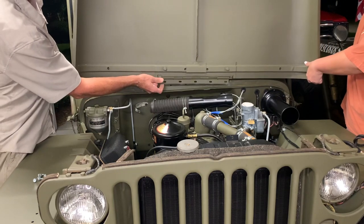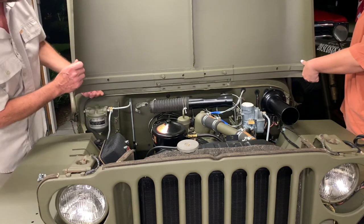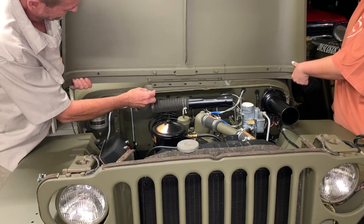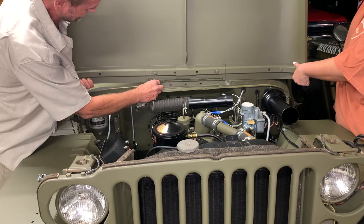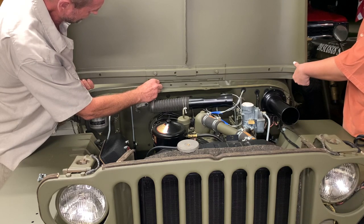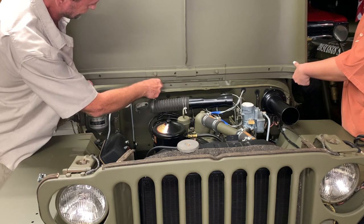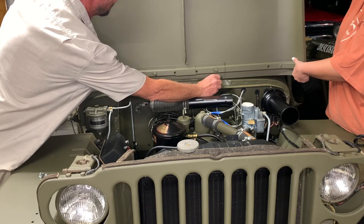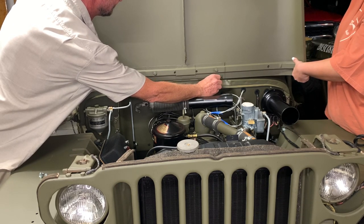It's really easy with a second person. You just hold the hood up and line the holes up kind of in the center, then take one of the bolts and lock washers and get that started. Once you get those holes lined up and that first bolt started, it's going to make it a whole lot easier — but getting that first one in sure is a lot of fun. I might add I've only put two coats of red oxide primer and two top coats of the 33070 OD Green on all of my parts. After I get this all assembled, I'm going to scuff it one last time and give it a last coat of paint. I've got the first bolt all threaded in, and I'm going to tighten it up finger tight, then reach over and line up the hole furthest to the driver's side, doing the two ends furthest from center first to keep everything steady and lined up.